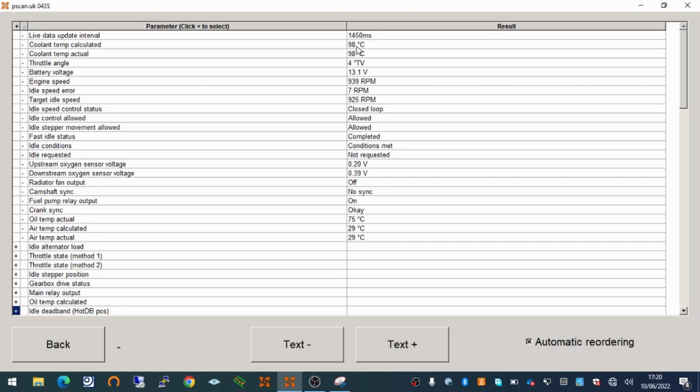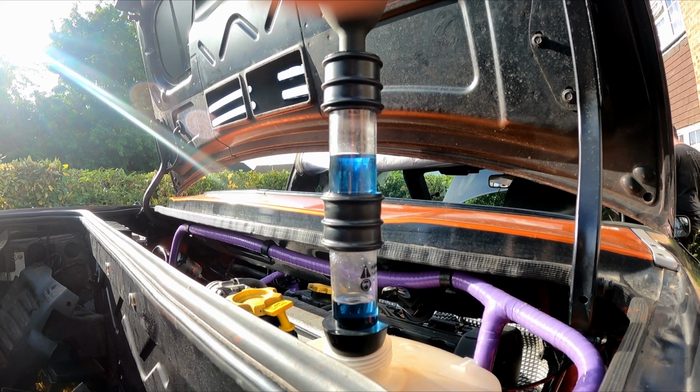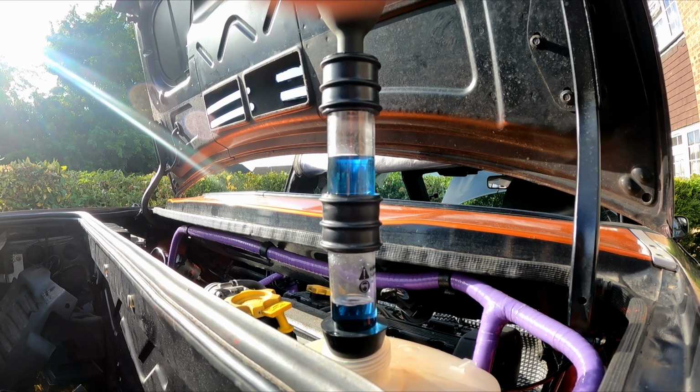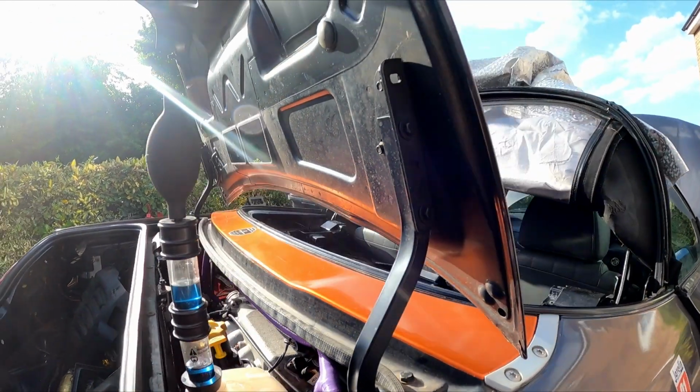Apparently we have a bit of a problem, because although the engine temperature continues to climb, the thermostat in the PRT hasn't opened. After bleeding the system again, everything worked perfectly. The thermostat opened when it should, and the radiator cooling fan came on at 106 degrees and went off at 97 degrees. Having sorted out the notoriously finicky cooling system, we checked for exhaust gases in the coolant. You can see that the blue liquid didn't change colour, so all is good.